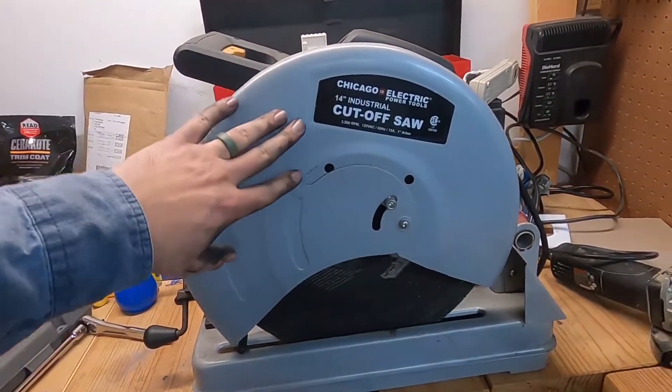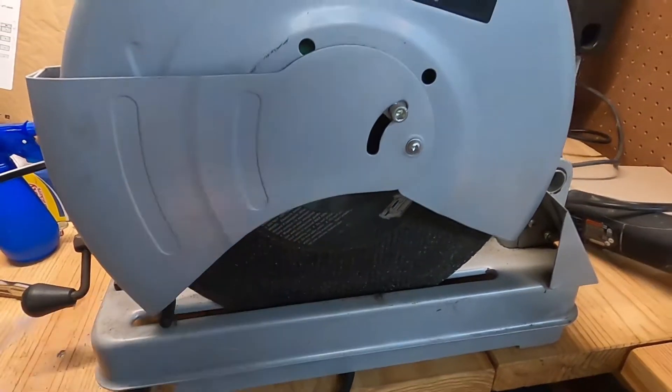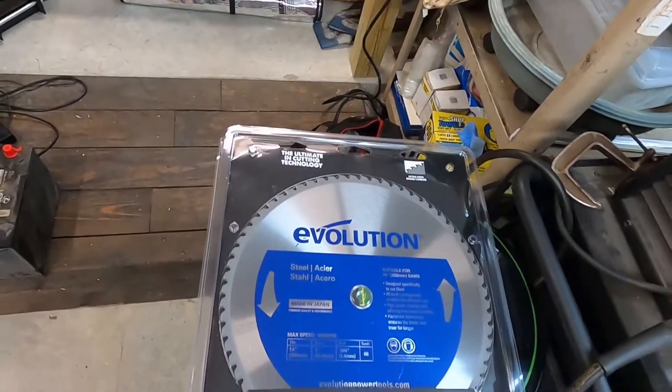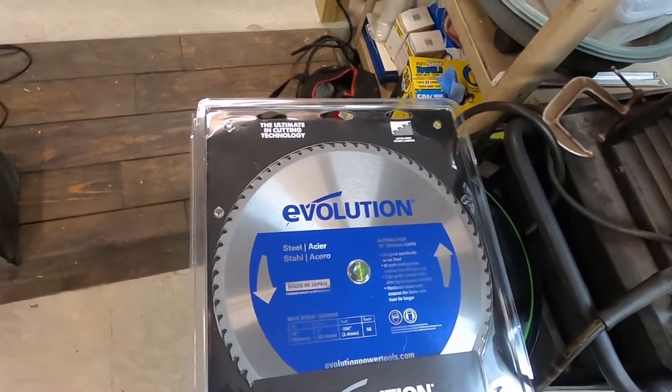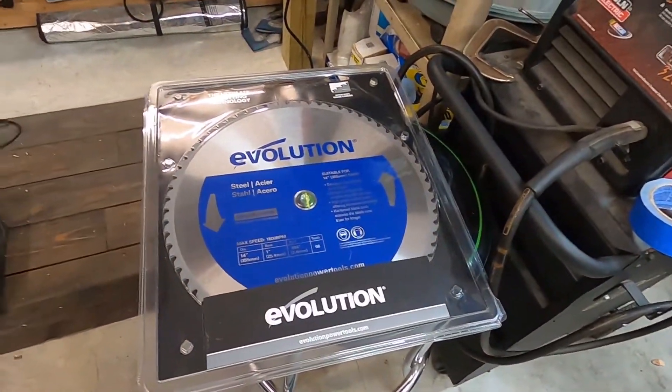So I'm about to start cutting up some steel, and before I did, I wanted to show y'all something. Most people use a metal cutoff saw and they have these abrasive discs on them — this one's just your plain old Harbor Freight special. But I'm going to try something. I've been watching a lot of videos where guys are using these steel cutting blades. I don't know how well it's going to work, but it reduces the amount of spark and all the soot and stuff that comes off those abrasive wheels. So I'm going to try it. They're not a sponsor or anything, just showing y'all what I use. And we'll see what happens.